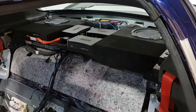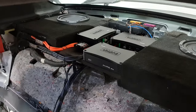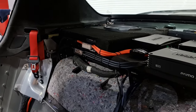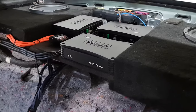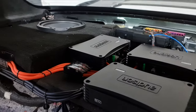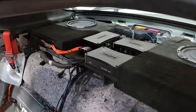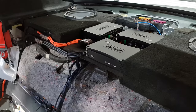As you can see, we've got two Audison Prima 8-inch subs mounted in custom boxes, and then we've got the three amplifiers that in the previous video you saw on the floor — now all carefully and professionally installed. We've still got a little bit of wiring work to do but a lot of it is done. All the cabling is really neatly run over into the amplifiers, and we've got all our fusing as well as all the amplifiers linked together. So we've got the AP4D at the front, then the AP1D towards the back, and on the left hand side there behind the sub we've got the brain of the system — the AP4.9 — which I covered in more detail in the previous video. So that's three amplifiers: a four channel, a four channel, and a one channel — basically nine channels of amplification — and the AP4.9 has nine channels of processing power.